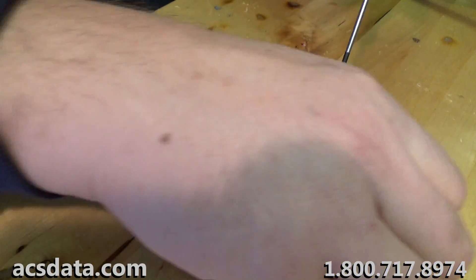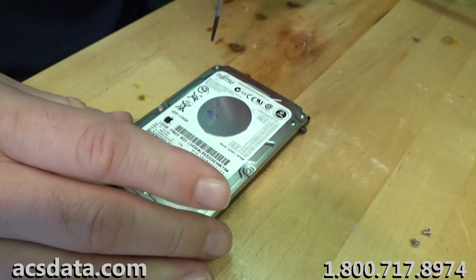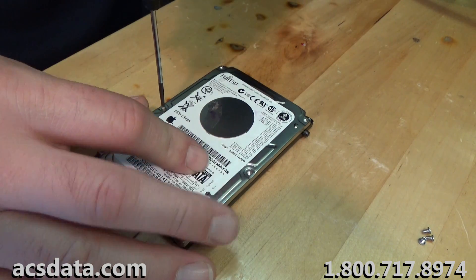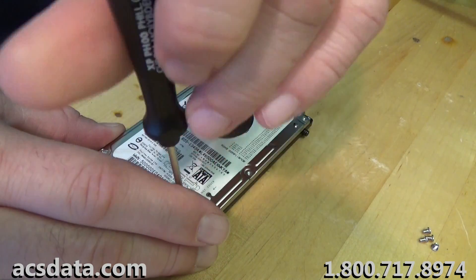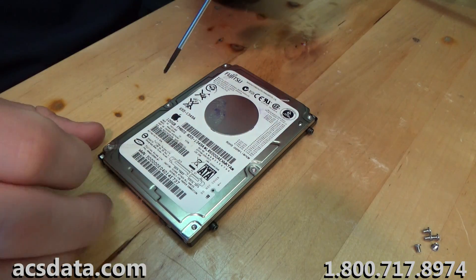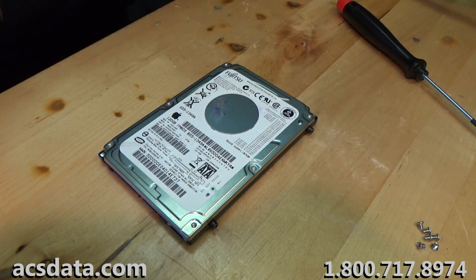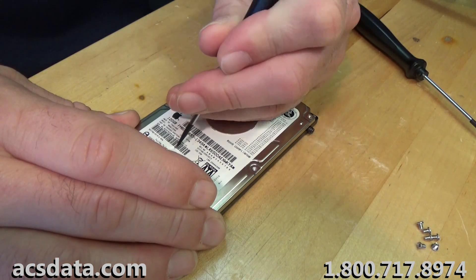I'll show you the right Phillips screwdriver. This is one of those few drives where some brands actually use a Phillips head screw — most of them use Torx screws, T-O-R-X. If you're ever looking to open up a hard drive yourself, you're generally going to want a Torx 6 on most laptops, maybe a 5 for most small 2.5-inch drives. For 3.5-inch drives, generally a Torx 8 is what's needed.